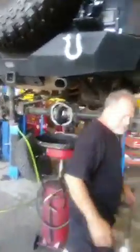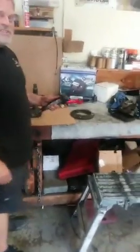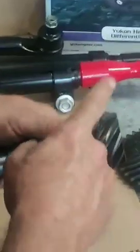Guys, follow me up here. So what we got here is a bunch of different pinion sizes, carriers, posi units, open differentials, stuff like that. Let's start over here. We were talking about chatter. This has been sent off for MagnaFlux. It shows distress points in the MagnaFluxing. They showed that the metal was stressed due to wheel shock. Basically, the same thing that happened on that differential over there happened here, but everything was transferred through to the pinion. This pinion lines up just like that.